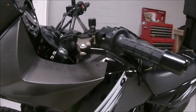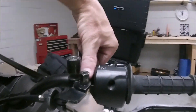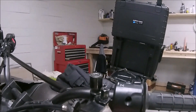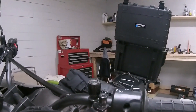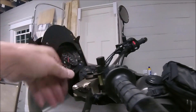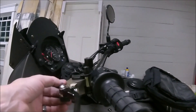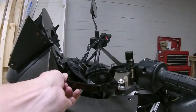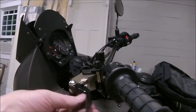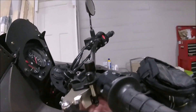Okay, so here's the clutch lever side — it went pretty smoothly. This bolt goes all the way through to the bottom, and there are a couple bolts on the bottom. This thing was stripped at the tip, so I had some difficulty getting the nuts back on, but otherwise it looks pretty good. I'm already kind of adjusted it. I love this part — you can bend it past 90 degrees. That looks pretty good. I'll put the Bark Buster on here in just a minute.